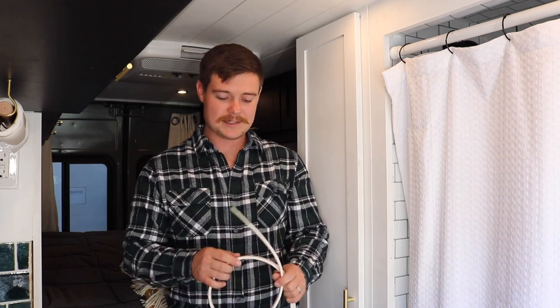So me being from the marine industry, that's what my background is in. I trust ABYC standards and know that when I see the certain markings on the cable jacket that it passes those standards, that's what I want to use. Even on the DC side of things with smaller wire and stuff of that nature, we still used marine grade wire. We actually used the same DECA Marine Master wire in our van, but just two conductors instead of three on the DC side of things to power our lights and other things in our van.